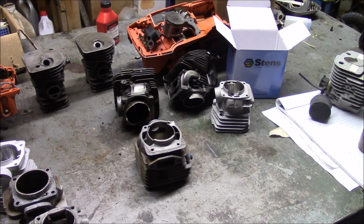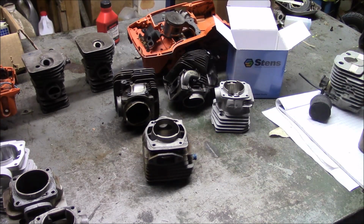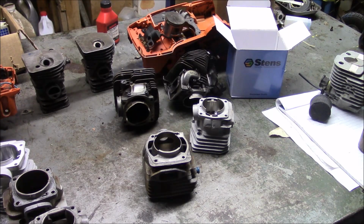And I guess theoretically what you get out of that kind of a configuration is because you have those two ports, it's not that you're going to get more cross-sectional area, because that's really going to be based on how much area is cast into the cylinder, but you allow the designer to have more control on how the charge exits the transfers into the cylinder. And why that matters is they can get a more efficient mix to the mixture, therefore potentially a more efficient burn. And also they can affect how the combustion chamber fills and have more control of that, therefore potentially more control of the scavenging, otherwise flushing out the old exhaust more efficiently and filling it with a new charge.